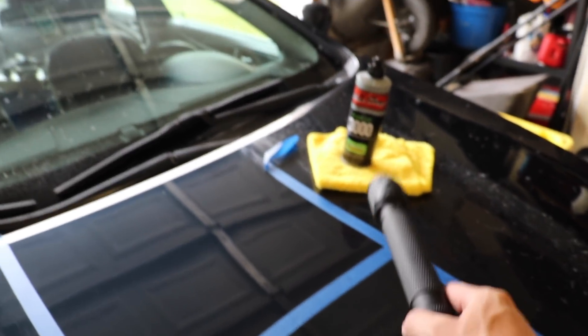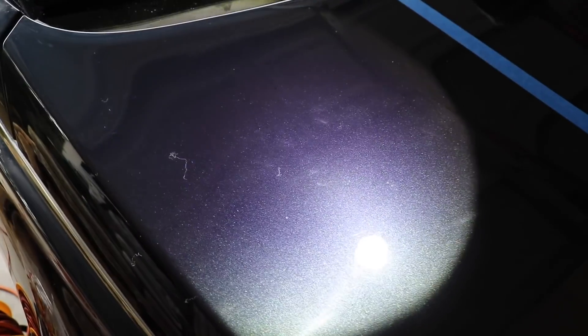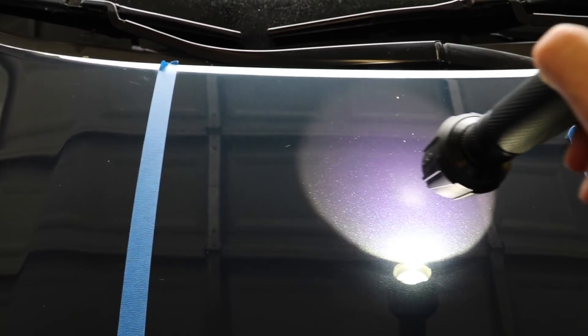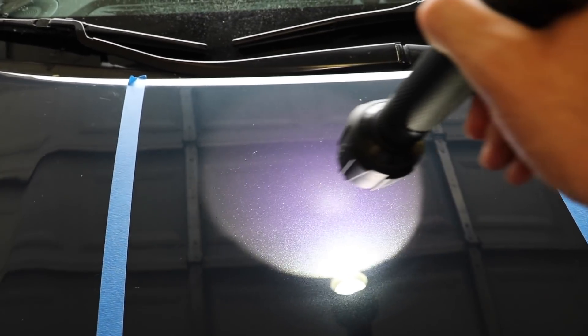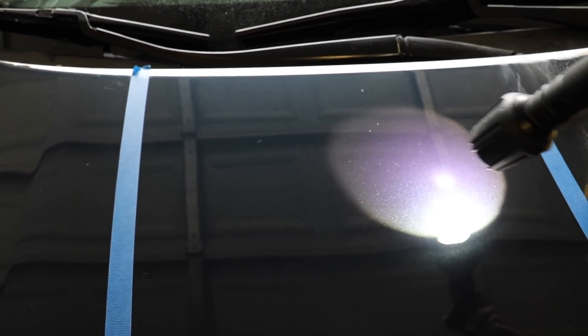We hit this square with the 1000, 2000, then the 3000, and you guys can see the 3000 is a low cut and a really high gloss — that is a finishing polish. Here's the 1000 with the rotary polisher — it looks really good but a lot of hologramming. Here we move to the 2000: rotary polisher then the DA with the 2000 — much less swirling, much less hologramming. And then here we've got the 1000, 2000, and 3000 — obviously this is going to be the best results. Really can't see a lot of swirls. I can see a little bit of imperfections, but that is to be expected with a car like this. And we'll contrast it with this panel which has not been corrected at all — tons of swirls.